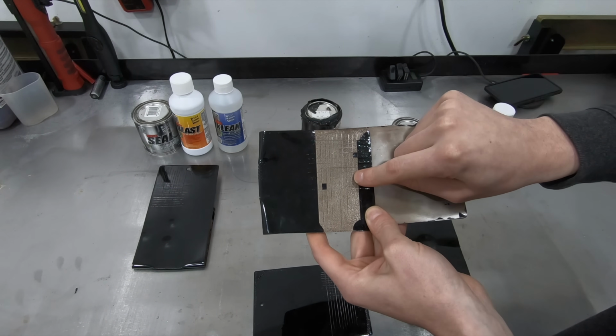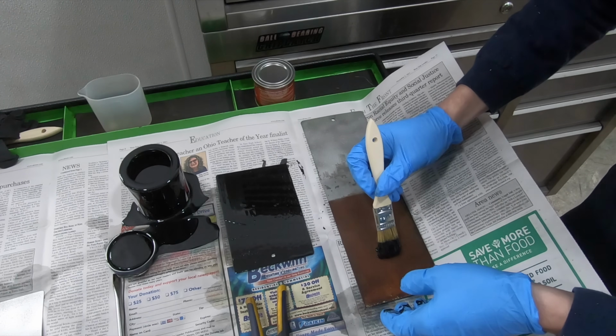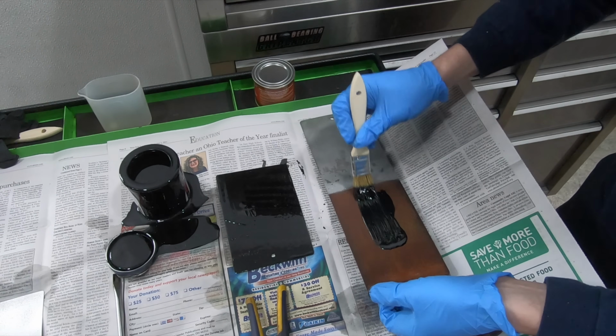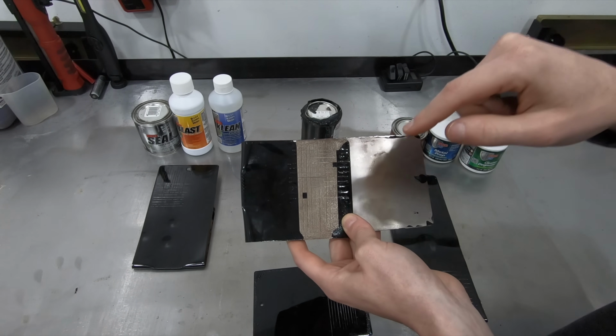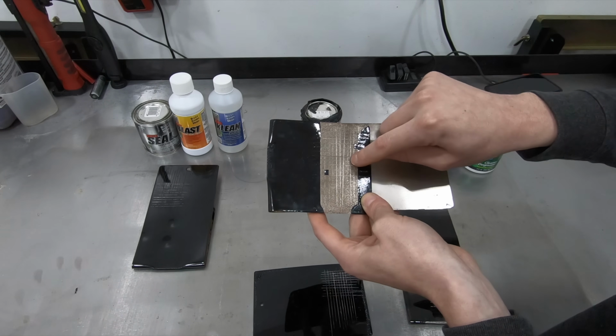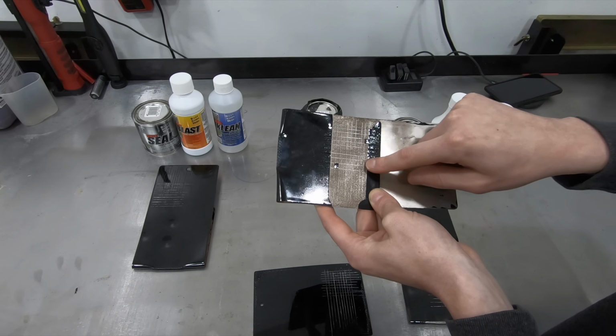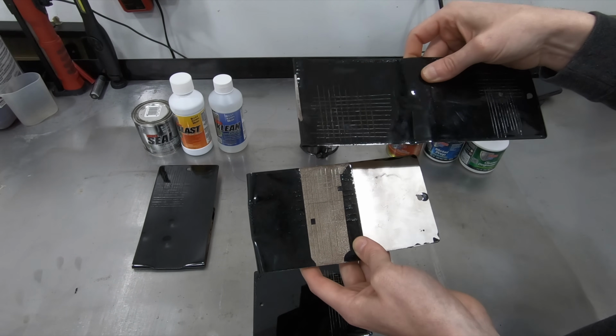Now, like I alluded to earlier, I did not use any sort of phosphoric acid prep like I did with the KBS Rust Seal or the POR-15. I simply did what was written on the can. Now, had I used the POR-15 or the KBS metal prep with this product, I could pretty much assure you that you would end up with the exact same result as what I got with the POR-15.